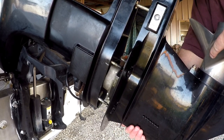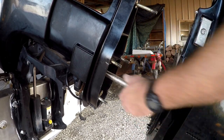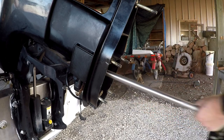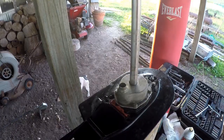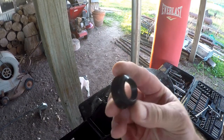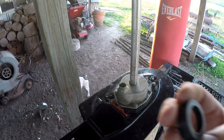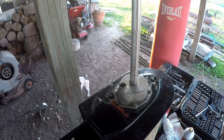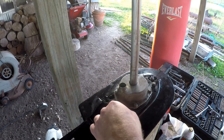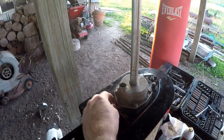This is the face pump seal, part number 42 under the gear housing schematic in the manual. If you buy an impeller kit, it comes with an insertion tool. You basically put the rubber face seal over the driveshaft and then use this tool to shove it all the way down, which gives you the proper spacing above the pump housing.